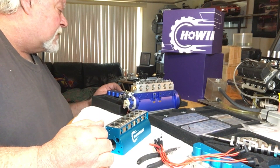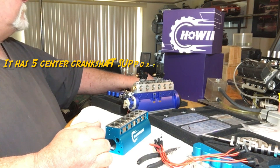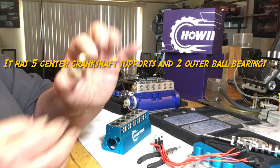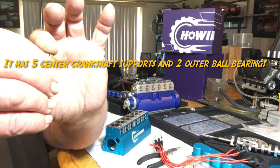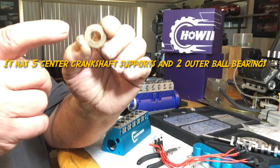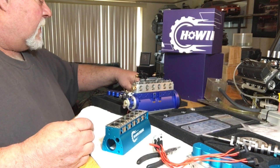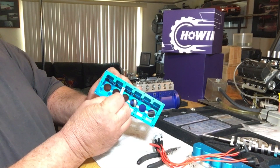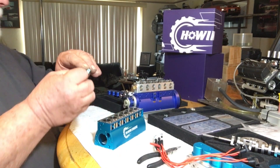This one uses the well-proven bronze main support for your crankshaft. I notice a lot of engines are using these now because they work. And of course we've got our main caps that go inside here to hold those bronze bushings in and support the crankshaft.